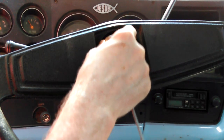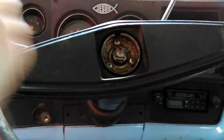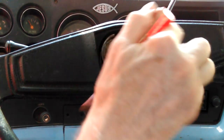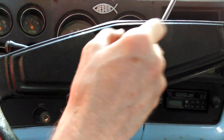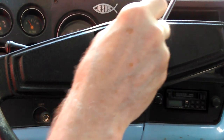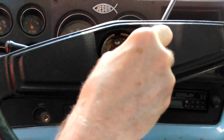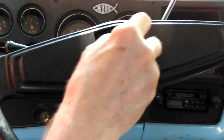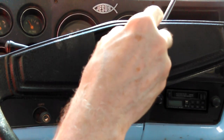Anyway, I wasn't really quite sure I would know. I think I could do it if the horn already worked and I was replacing this one with that one. But since I don't really know what's wrong, I wouldn't know for sure if I had it wired right. And I got to thinking, several times I hit it really hard and it worked. So it makes you think there's something in that switch not connecting good, and when you hit it hard, it connects. And it's connecting every time I touch this now. I don't know if you can tell, but it's moving real good.